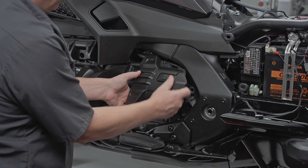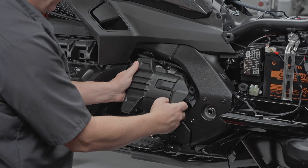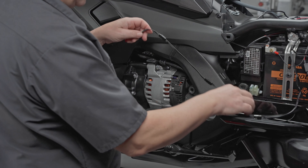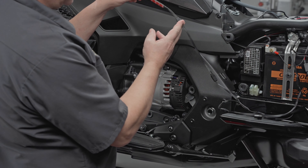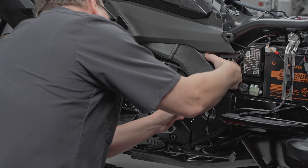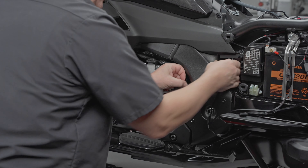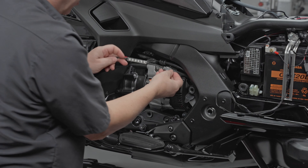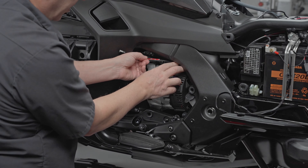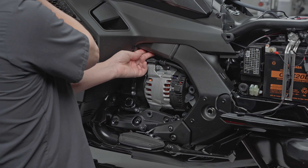We're going to feed this wire loom through the back behind the frame and back out here, and stick that next light right up to that part under the frame. Pull this cover off — it pops off from the bottom here and then comes up. Be careful because it's got a little top-down grommet, so lift it up when you do that. Now we can run this wire. We've added an 8-inch extension between the Y and this light pod, and we're just going to run that behind here.